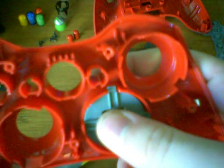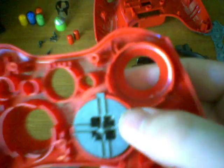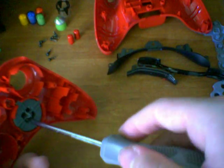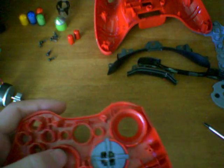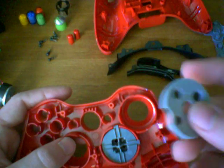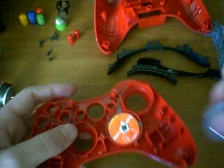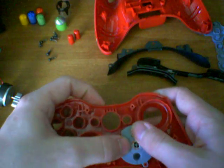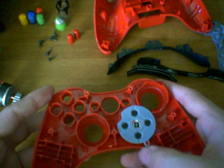It's important to be careful to not over-screw or over-tension, but do not under-tension as well. You need to get it to where it's taut and not loose, but don't overdo it. I would definitely recommend using a thicker screwdriver to avoid stripping the screw. Now we have the screws reassembled — it has a little bit of wiggle, but not too much. You should be able to look all the way down and see if it's pressing the bottom. Now that the D-pad is reconnected, we're going to take this little squishy part and reapply it. All we have to do is push down on that little tab and it kind of sinks into place.